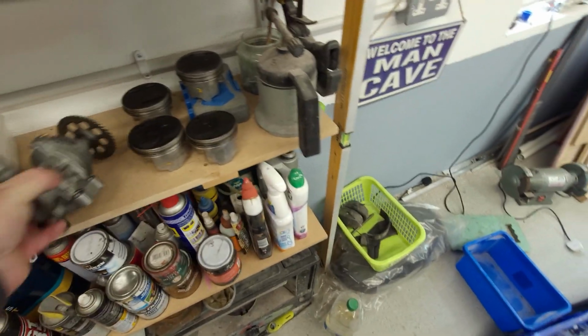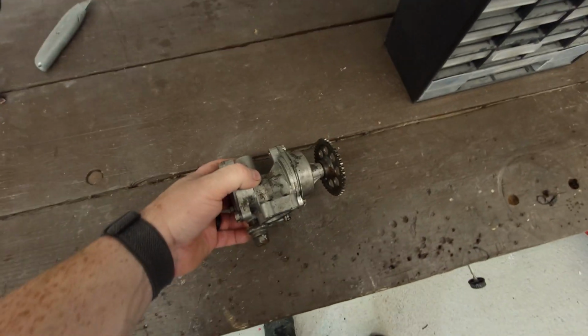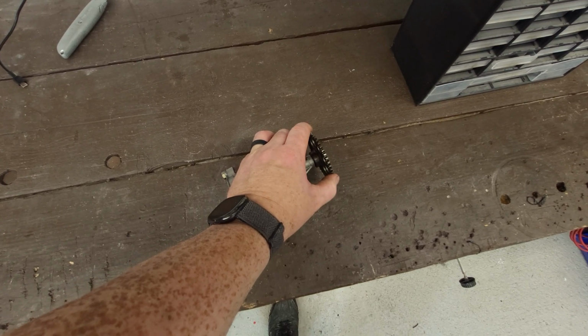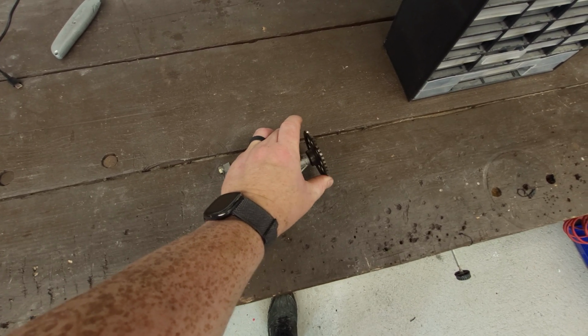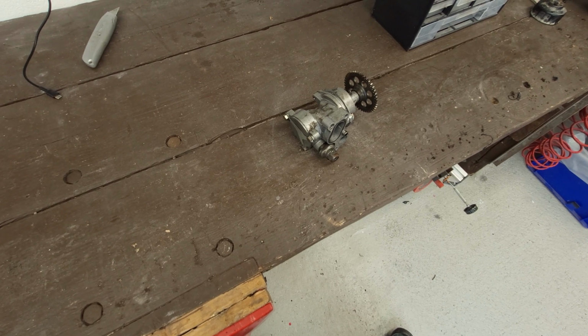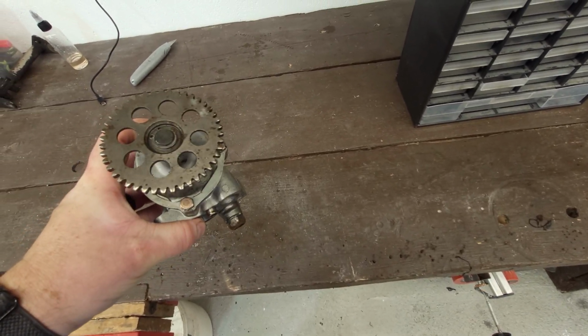This is an oil pump here. This was in the engine that was in the bike, and I'm probably going to do an autopsy on that, because it feels like there's something in it, which is why the stiff spot there, but only after a full revolution. I think there's something in it, so we're going to crack it open and have a look. It says in the manual that you're not supposed to open them, but I have two more there, so I'm not too bothered. And we'll do a video on that. We'll crack it open and see what's the story inside it.